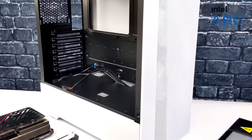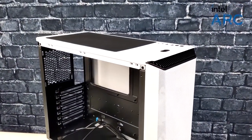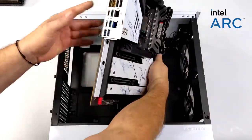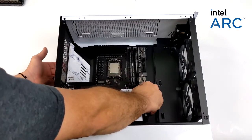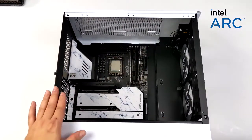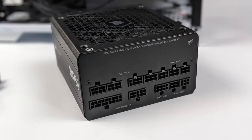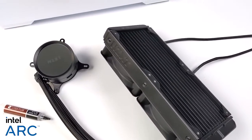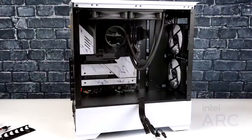For the case I opted to use the Phanteks A360 — I've used the black version before and personally these are some of my favorite cases for their design and price. It has great cable management and comes with two RGB fans up front. It supports up to a 280mm radiator, which should be fine for the i5, though for an i9 build you'd want a 360mm and a larger case. For power I'm going with a Corsair RM750, and to cool the i5-13600K I'm using an NZXT Kraken X53, a 240mm AIO — though I wish I'd gone bigger given I wanted to overclock.